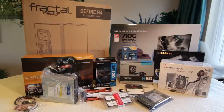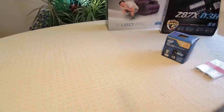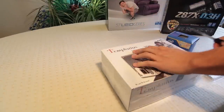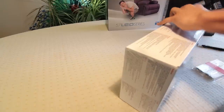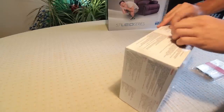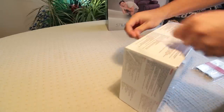We'll start getting into it. I think I'll start with an outside build — put the motherboard down on the motherboard box, plug in the power supply, put the processor and RAM in, and just test that everything is working. I'll get everything out of the boxes first. For this out-of-case build we just need the power supply, the motherboard, the processor, and the RAM.